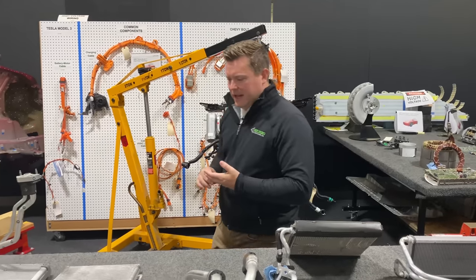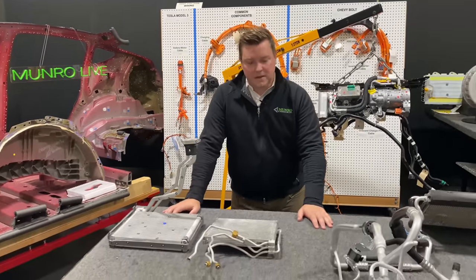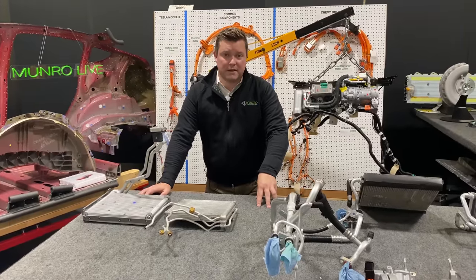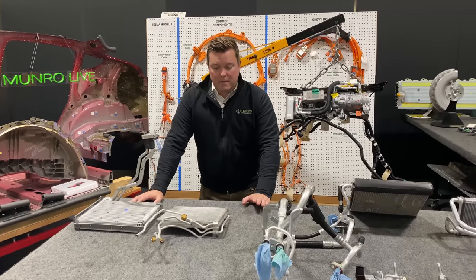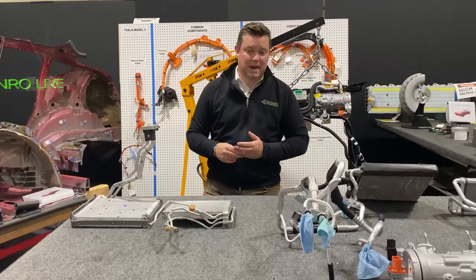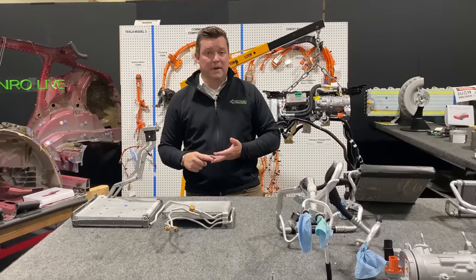When it comes to electric vehicles, they really struggle to generate heat in very cold environments. Early Tesla Model 3s did not have a heat pump, and they performed poorly from a range perspective in northern climates, Norway, Alaska, and whatnot. So now moving forward, all Model 3s and Model Ys have heat pumps. Many other EVs also have heat pumps or have plans to have heat pumps. The Nissan Leaf has a heat pump. The Jaguar I-Pace has a heat pump.